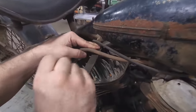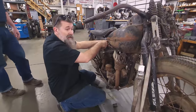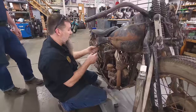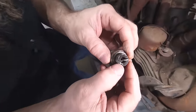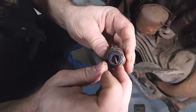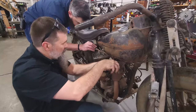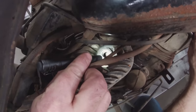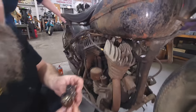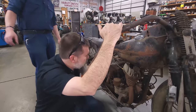So rusty, crusty motorcycle — obviously running at some time before we got it, though I don't know how long ago. The spark plug is a little sooty but it's not white powdery. It sure wasn't running lean, but it wasn't running rich either. What's it look like in there, Chris? A little bit of rust there on top of the valve. Oily — this is the Croil we've been spraying on it. Compression, Chris — give it a kick.